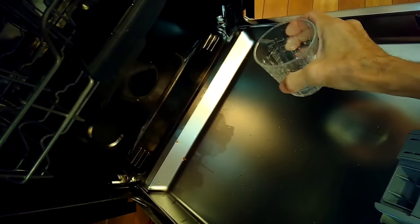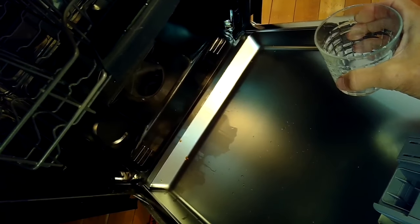I'm going to pour a little water down in there to check for leaks. The water should stay in the sump, and when you look at it from the other side you shouldn't see any drips. If there are drips, it means you just need to get it seated in a little bit tighter. This one did not drip — it was in there correctly right off the bat.